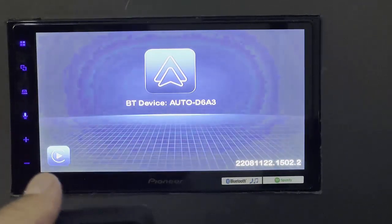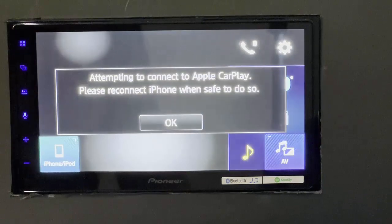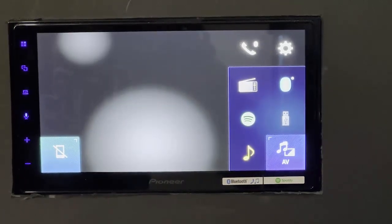We have the unit here and the USB stick, and we're just going to plug the USB stick in like that and leave it there for two minutes. Once it's plugged in, the device is going to reset because it's going to start loading the new file into the system. The software update is going to take a couple of minutes — not too long. Just be patient, set a timer for two minutes. Right now the device is resetting and loading the software update we need for LDV, MG, and related models to work nicely with the CPAA and connect with your mobile phones.